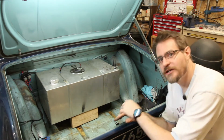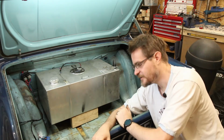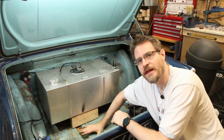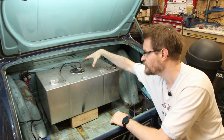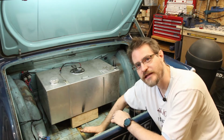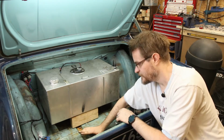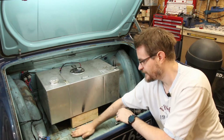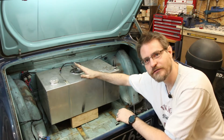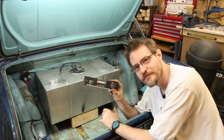Yeah, we've got a little bit of a height difference. I will use my spirit level to get an angle off of the boot floor, and then I can transpose that angle onto the tank, and then I'm assuming that Ford made the original floor pan pretty level with the rest of the car, so it's a good bet that taking this level, transposing it up to here, will give me a good level on the tank. Those of you who watch Project Binky will recognise this.